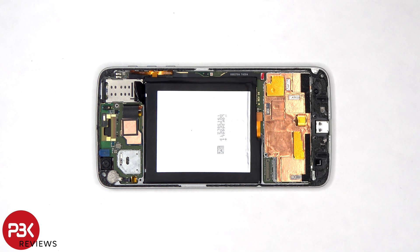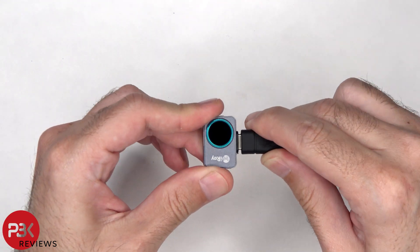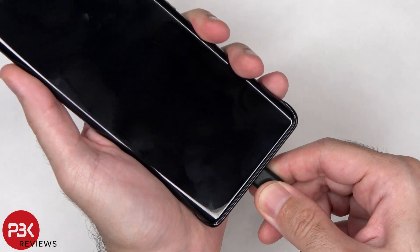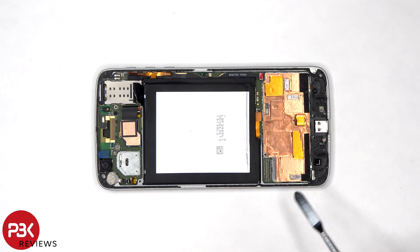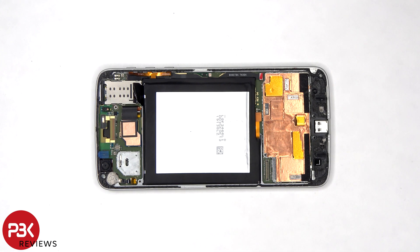I don't have a faulty board on hand at the moment, but say for example if I want to check this board for any faults, issues, or possible shorts, I'll take the P2 Pro camera, connect it to the extension cable, and then connect it to my phone. At which point I'll be able to use the thermal camera and check to see if there are any hot spots on the board to identify a spot that has a defect or a problem. Say for example on the smartphone board the SIM reader wasn't working and one of these chips or resistors was the culprit — using the P2 Pro thermal camera we would see a heat signature over here on one of the chips or resistors, identifying it as the defective part or component.